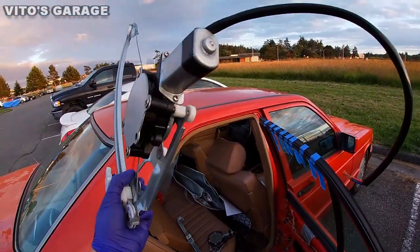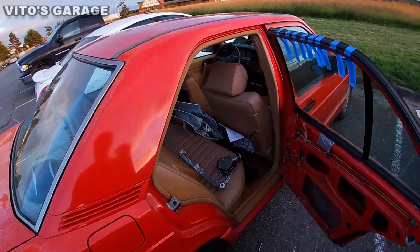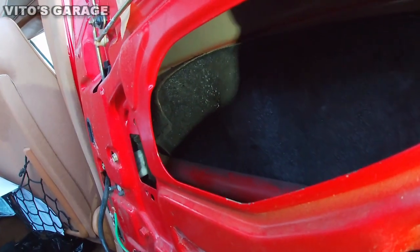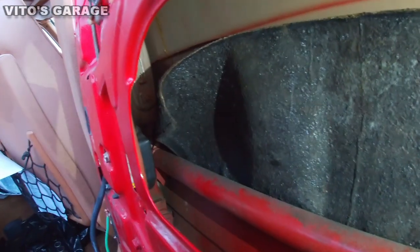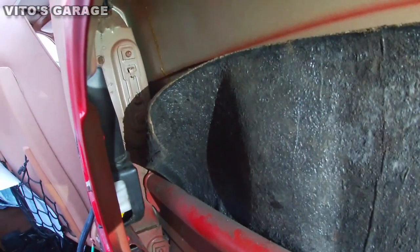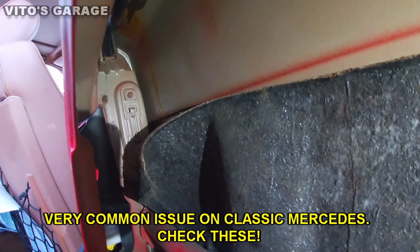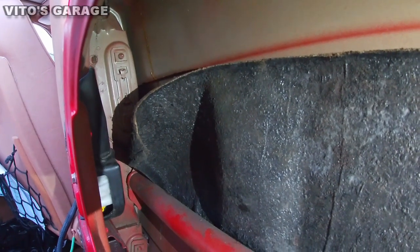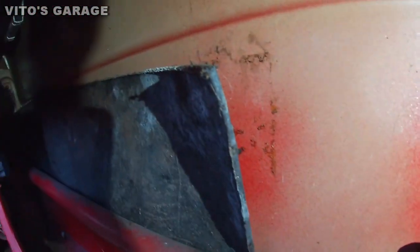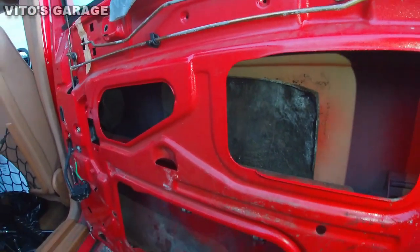I'm not too sure about the dry tracks, but we'll see. Let me show you the real problem why the window had issues and why that regulator wasn't working properly. We have a factory installation here for the door sound deadening that's coming off, and as the window was going up and down it was hitting that material and causing problems. This sound deadening definitely caused issues with the regulator, and it needs to be re-glued properly.